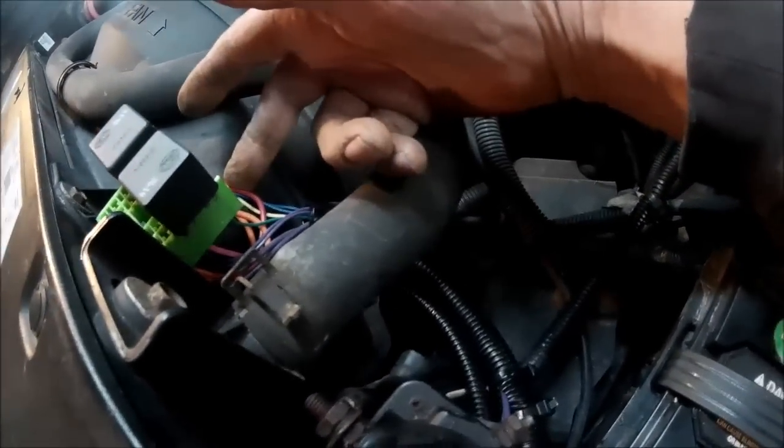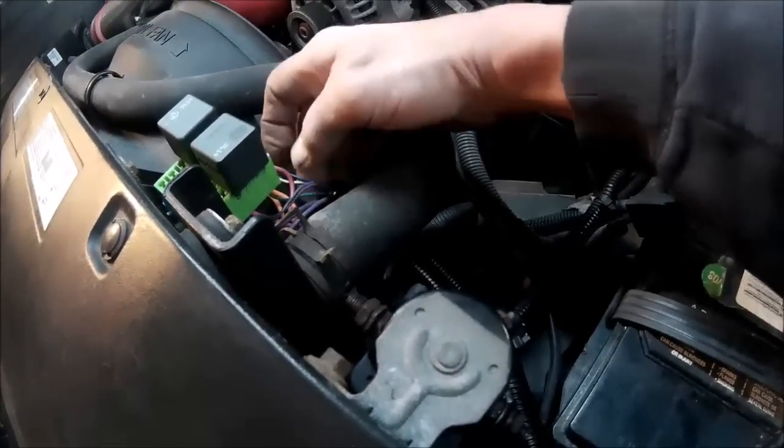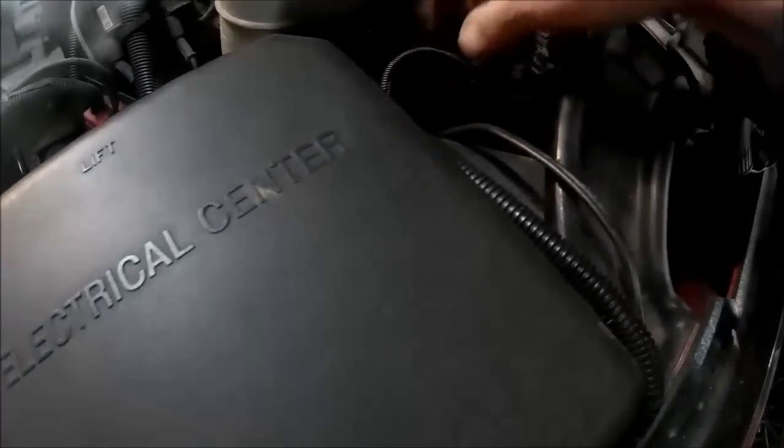On these are the plow lights, and the rest of these are all the switch wires and that stuff. All those run inside of a loom back in here, and then run back in here. We drilled a hole through the firewall, put a grommet in, ran these wires back down inside into the cab, and this wire here is our light that's underneath the hood, our temporary light that we just got. And if you can see, this is our switch here. That's truck and that's plow.